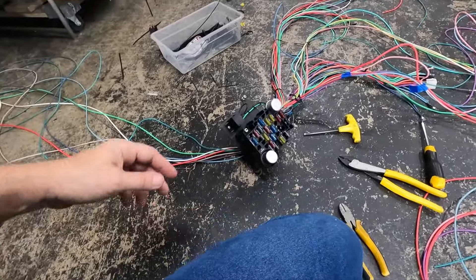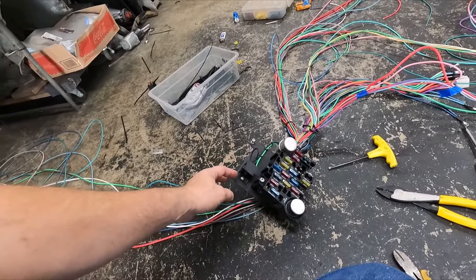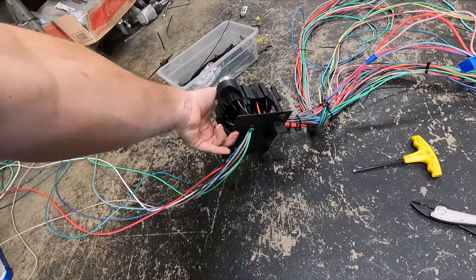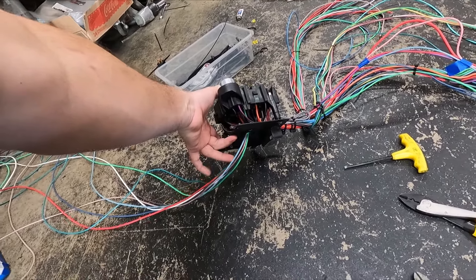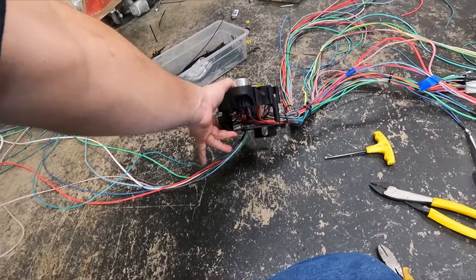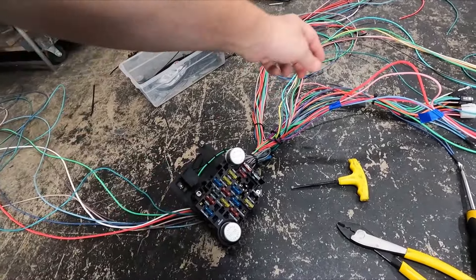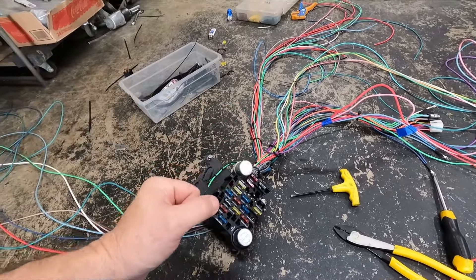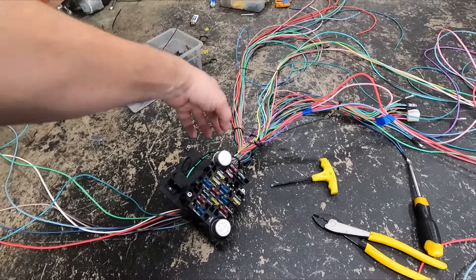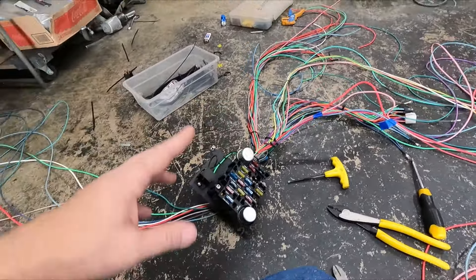Man, that was a job. I've got the harness permanently mounted to my bracket, the relay bracket permanently mounted, and I've got the wires run for the engine compartment harness going through the rubber grommet. These will go right out the firewall through another grommet out to the headlights, turn signals, and alternator. It was quite a job to make the wiring go up instead of down because when you turn it up, some wires are pulling short and some wires are wadded up because they're too long. You have to go through and give slack or take slack away — it was not fun, but I got it.